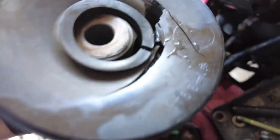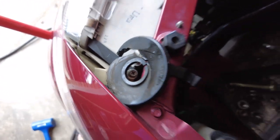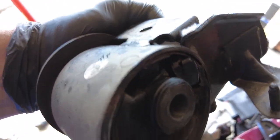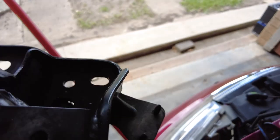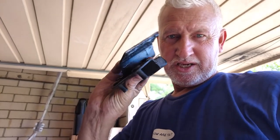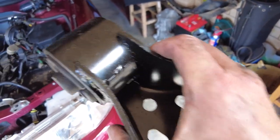There was a bit of messing about. Looks like I'm missing a rubber that was on the old one and the new one doesn't have it. Look at that - she's way off center. That's the weight of the engine and gearbox pulling downwards which has slowly destroyed the mount. We'll put the new one in. We've now got two mounts out. This is what they call the dampener mount at the bottom of the car - it was in two pieces, so it wasn't even doing anything.